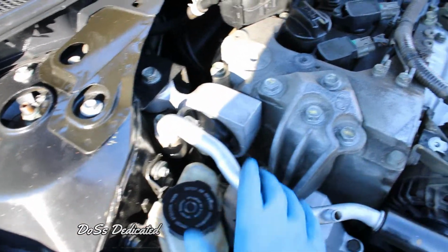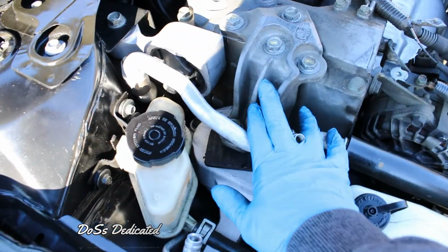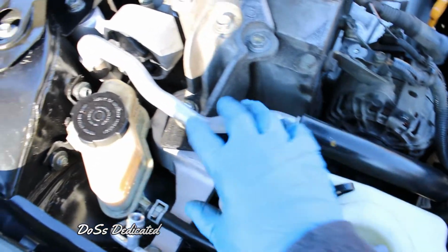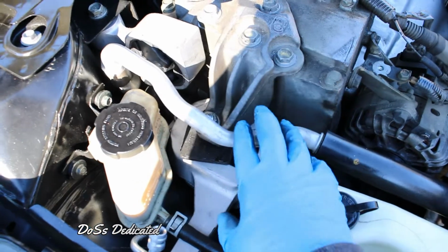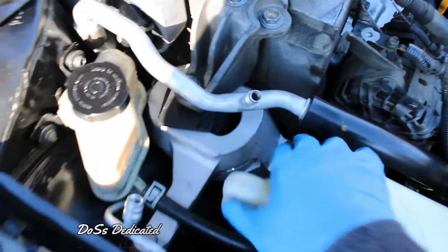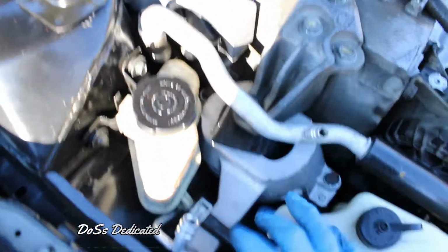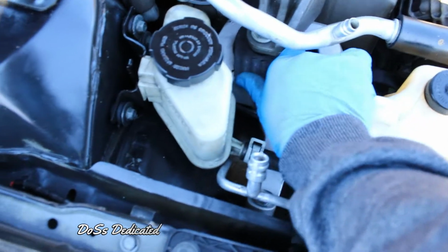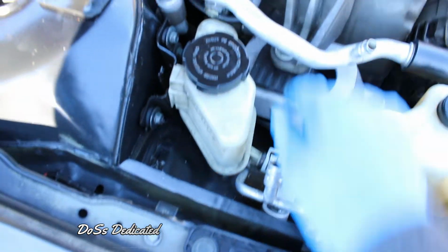And then you unloosen this right here. Then you actually take this off. Make sure your jack's up underneath your engine, though. I gotta secure that. But anyway, after you take this off right here, now you're gonna want to go ahead and loosen these up. These three, there's three that hold this in. There's one right there, one there, and one there. Obviously, as you can see, when you have the part with you, this is actually probably supposed to be over a little bit. There we go, right there, just like that.